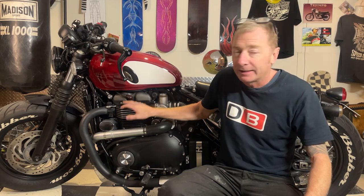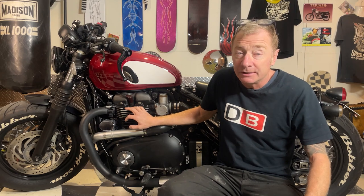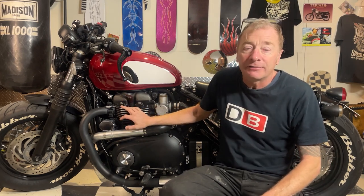That compression ratio is a little bit too high for the supercharger, and they're not forged either. I've actually think I've already hurt the pistons in it on the dyno because I leaned it out instead of richening it up at one point, and it's breathing pretty heavy now.